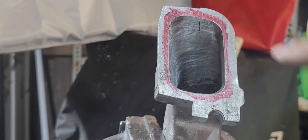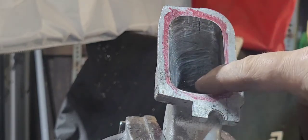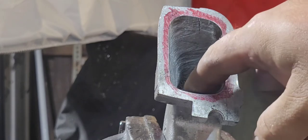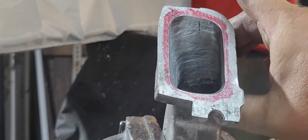What we've done is gasket matched to about a couple of millimetres and put it on the flow bench. Didn't really see much change. So we've ground, or ported, to the pinch point, which is about center-way of the port.